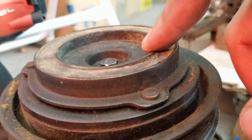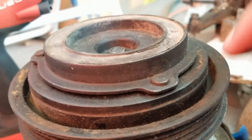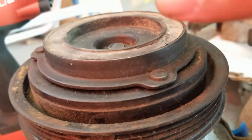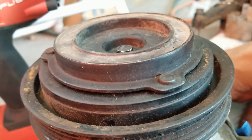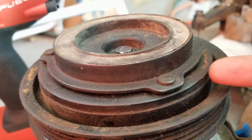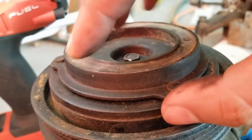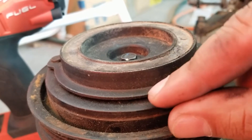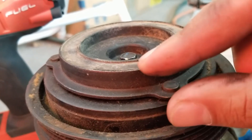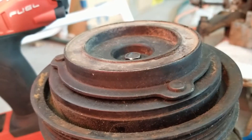With my car — my FA5, my 07 FA5 — taking out that smaller shim was enough because the gap was cleared. What happens is the clutch material wears as it engages and disengages over time, so this gap opens up and eventually becomes too great for the electromagnetic coil to overcome and close that gap. That's why you have to adjust it.